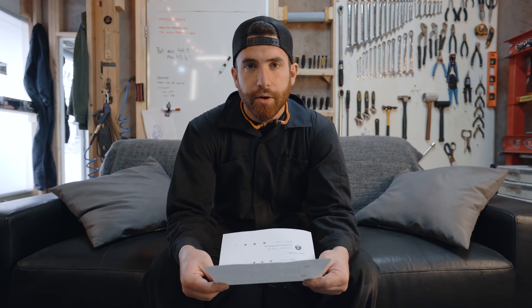After that, you can do a couple little bolt-on things — adding a filter, adding a header, adding exhaust. All these bolt-on things will make a little bit of a difference. Because the computer that runs the car is the main determining factor in performance. In order to make any real headway, you need to get an aftermarket computer. There are a couple different companies that make ECUs for this. Specialist Components make a plug-and-play ECU that you just plug right in and then you can have full tuning capability. Even with just normal bolt-ons — like 1.5 rockers, intake, header — with the computer you'll be able to make some pretty significant changes. So for anything more than just basic bolt-on stuff, you're going to want to go with an aftermarket computer.